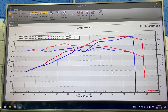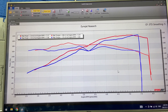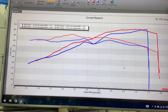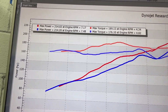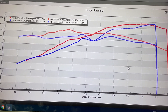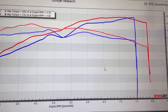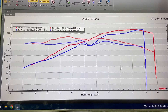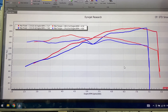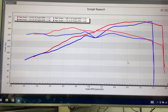Up on the screen in red are the results from today with the 4-piston drop-in cams. In blue is a 9th gen Civic Si I tuned that was full bolt-on — cold air intake, bigger throttle body, RBC intake manifold, set of injectors, full exhaust and everything. If you just go by peak horsepower numbers, both setups put down 214 wheel horsepower. But if you look at the area under the curve, these 4-piston cams without the RBC intake manifold put down a significant amount of power from basically 3,000 RPM up to almost 7,500 RPM — more power everywhere in that range. Pretty good results. The owner does plan to swap in an RBC intake manifold at some point, so when he comes back to retune, we'll have really good data on the difference between the stock intake manifold and the RBC.